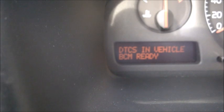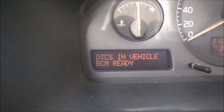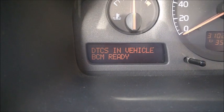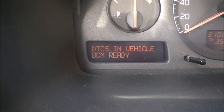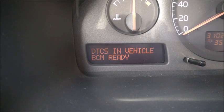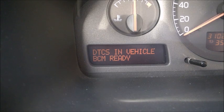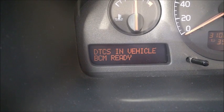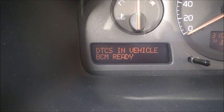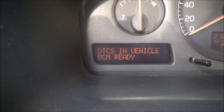That's pretty much it - sorry it was a lengthy video and my camera went out of focus. Check the video description - I'll list the modules you want to check first. Some are important, others less so. For all-wheel drive cars, the all-wheel drive system had a lot of problems up to 2007. There's an electronic module called DEM which is very important - if you have a code on it, that module is very expensive and will make the car undrivable when it gets corrosion inside. This is a quick but important check when buying a used Volvo - it may save you money and help you negotiate the price.